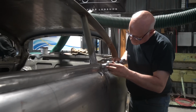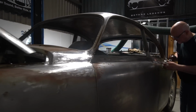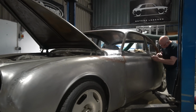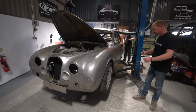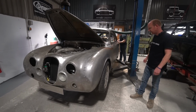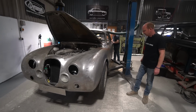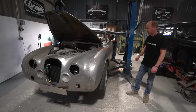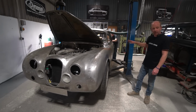It tends to lose that sort of plastic point that I was talking about earlier once it's been remelted, so it's not very good for fine-tuning lead work, but it can be used where you've got a heavy fill to do. So we've got a little mould that we can recast bars of it into. Should we see the reason to do that, which there will be on this car, because there's a huge amount of lead filings going to be generated by the process. So yeah, that's where we're at on all that.